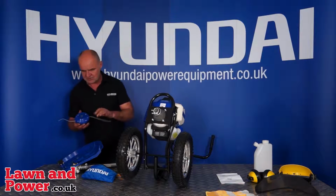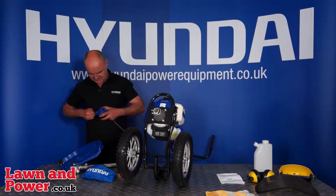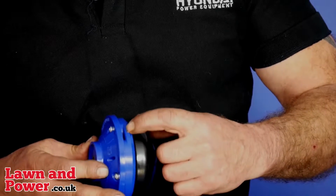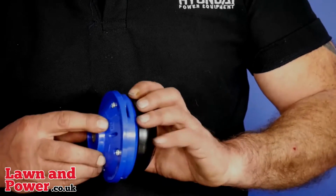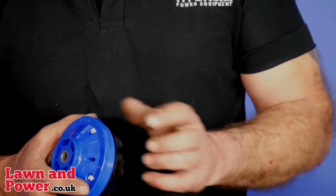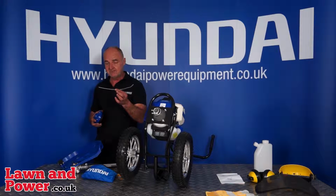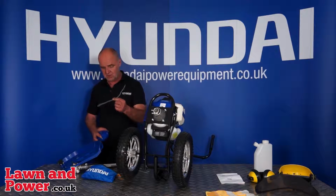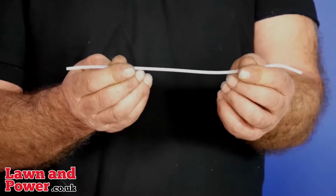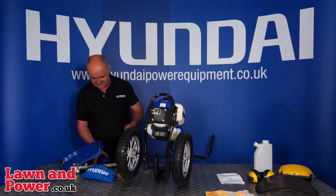Before I do that, I'll just show you how to load up the strimmer head. If I just remove the cutting cable out of this one. On the strimmer head itself, you'll see that it's got 2 elongated slots, 180 degrees opposite each other. And that's where you feed in the cutting wire. Now the cutting wire is 3 mm in diameter, and it's 270 mm long. So if you buy a roll of 3 mm strimming wire, you're looking at 270 mm. That's the ideal size, snip it off and fit it as I shall show you now.